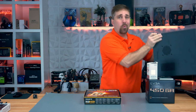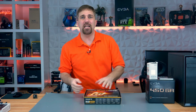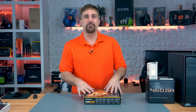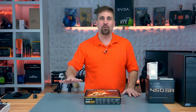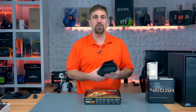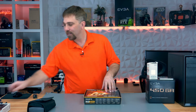But what are we actually trying to accomplish here? Well, first step, let's give you a general idea of how to assemble all this, and we're going to start by building the system outside the case. Now, I have a fancy setup here with a grounded anti-static mat on my workbench and a multi-bit iFixit toolkit, but honestly, you can do this at your kitchen or dining room table, and the only tools you need is a Phillips head screwdriver, and in this build, a pair of pliers.